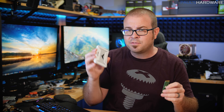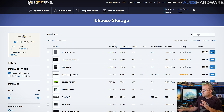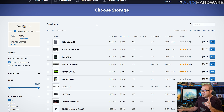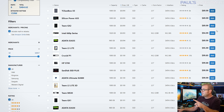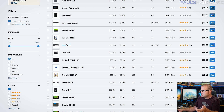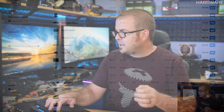In the past I'd tell people you don't really need NVMe, you can get away with a less expensive SATA SSD. But right now if you're shopping, looking at one terabyte SSDs on PC Part Picker, you can get SATA SSDs for under $100 - ninety-dollar one-terabyte SATA SSDs, great for a games storage drive. But for just five dollars more you can get an Intel 660p series - not the fastest NVMe SSD but still significantly faster than a SATA drive. You can also find a Crucial P1 or drives from Team or Mushkin.